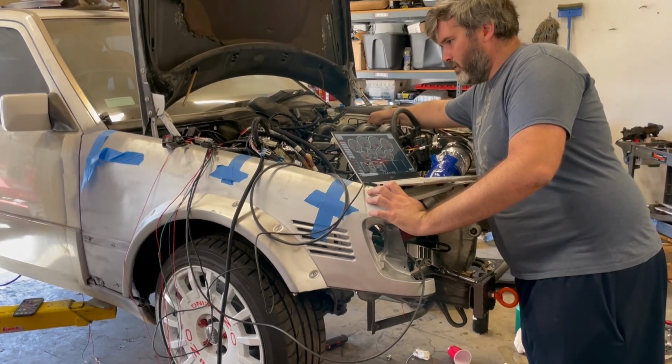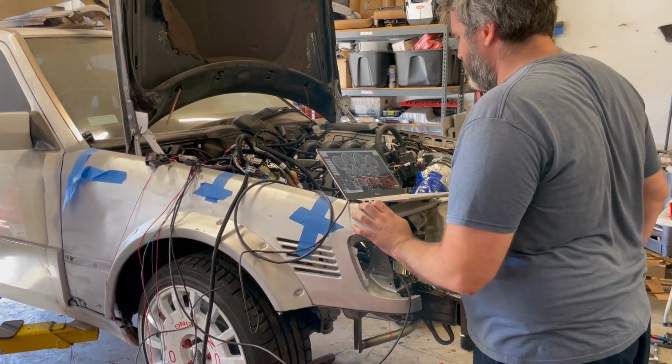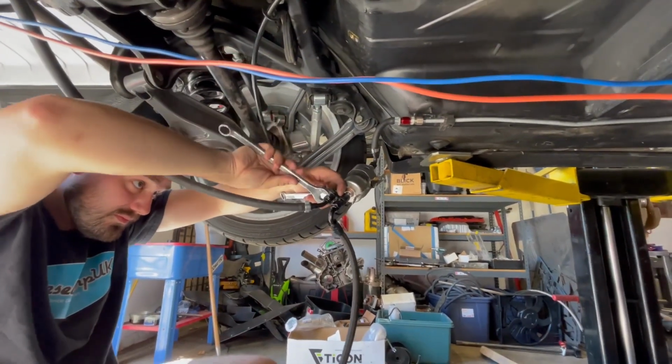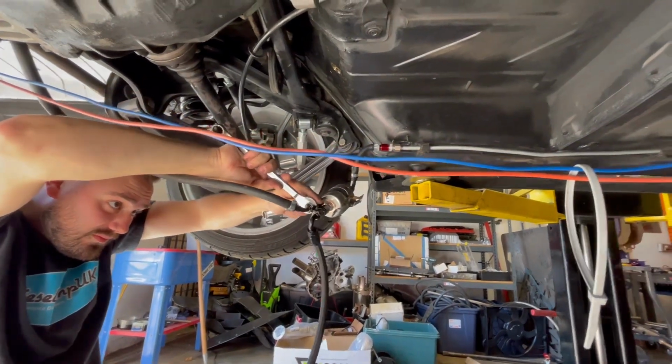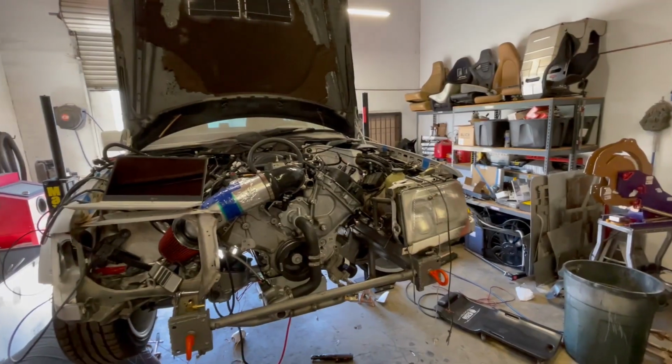Is that fuel on? Yeah. I'm not seeing any fuel pressure. We had our fuel pressure regulator plumbed up backwards because we had switched the feed and the return side of it to the same size. It was easy to have them mixed up and not know about it. And nobody checked. We just all assumed what the way it was going to go.